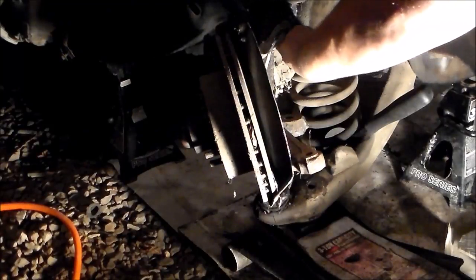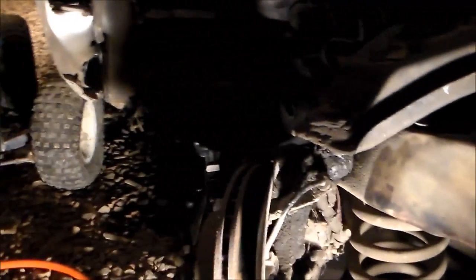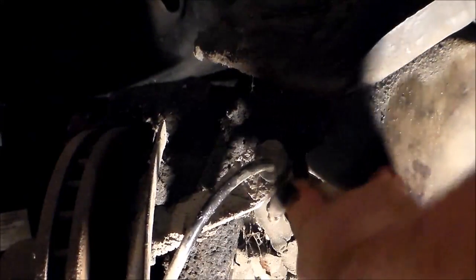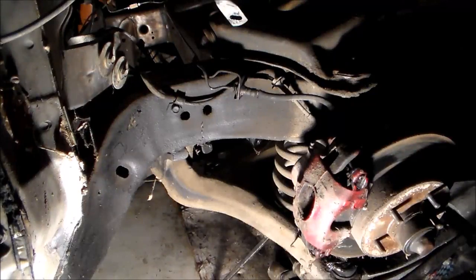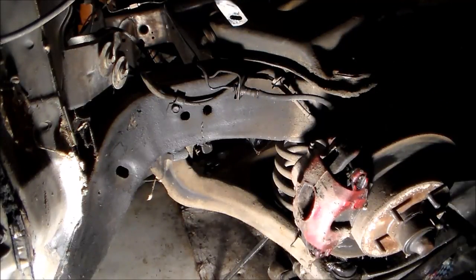Let me see if I can get you to see — right there — this is the upper ball joint and it is packed full of crap. I know it's shot; I've never replaced it. You can find the cotter key in there. Let me clean that off so I can see what I'm doing. Before I pull it off, I think it'd be best to pull the top control arm off with all the brakes, so I'm going to pull this off — which is my brake line — that way I can just pull that whole top part out in one.